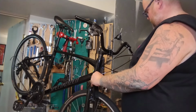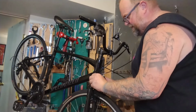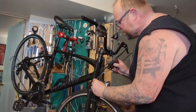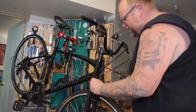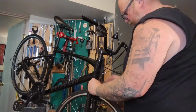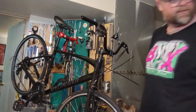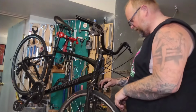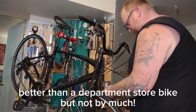Getting it loaded up. I'm just going to go ahead and lube this little V-brake noodle too. Just 1 or 2 drops of lube. Not too much. Don't want it pouring all at the bottom. Onto the tire, onto the brake surface. Ugh. Nice one, Specialized. Real high quality brake you got there. Junk.